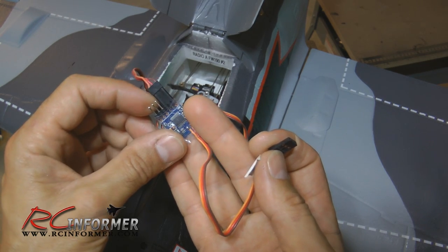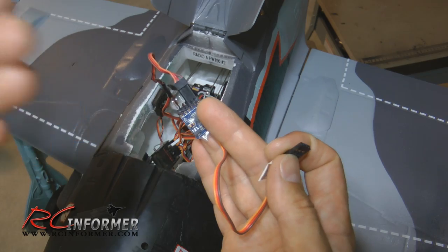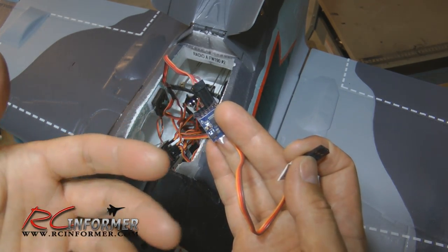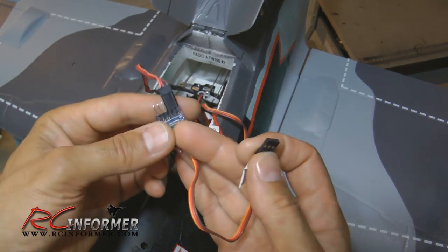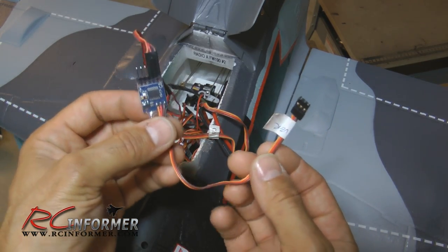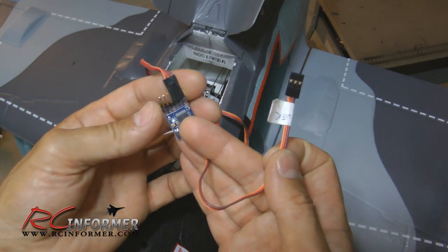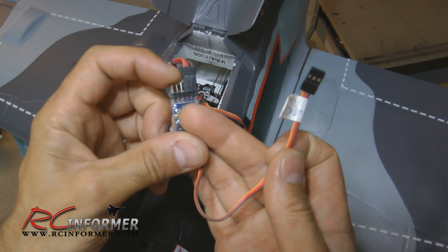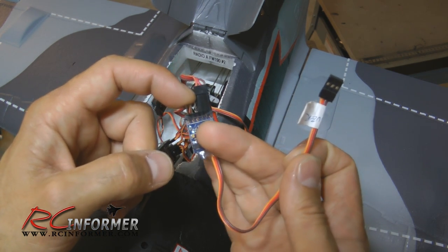So when you retract the landing gear, the landing gear would come up, and then the doors would close. And vice versa, you put the landing gear down, the doors open first, and then the landing gear comes down. Now, obviously, we don't have a second set of gear doors on this airplane. But for some reason, this sequencer works to get the version 1 landing gear to work. The only difference is you don't plug anything into the door side of this thing.